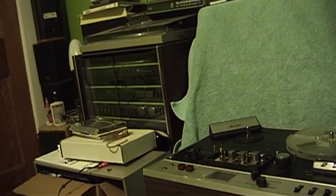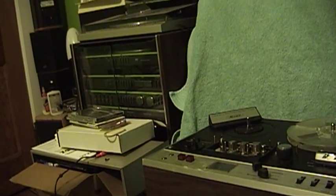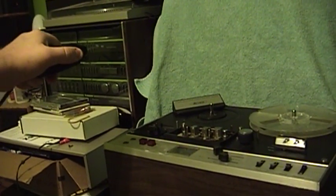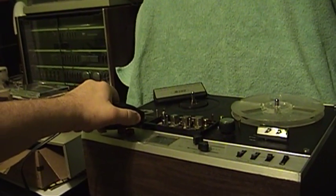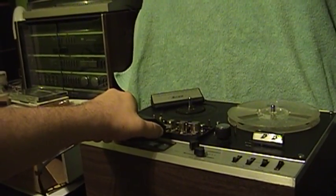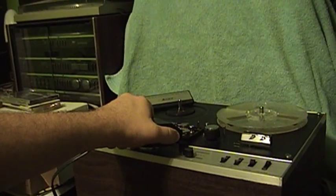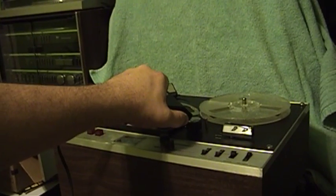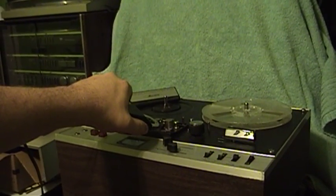It has no power light but I can feel it humming. And I just slowly, slowly, slowly — that is the key word to any of this — bring it in to the tape heads and the tape path, and gently bring it up to the major functional components of the tape deck. The key word is slowly, because if you go too fast, you will make the magnetization problem worse — maybe even much worse.